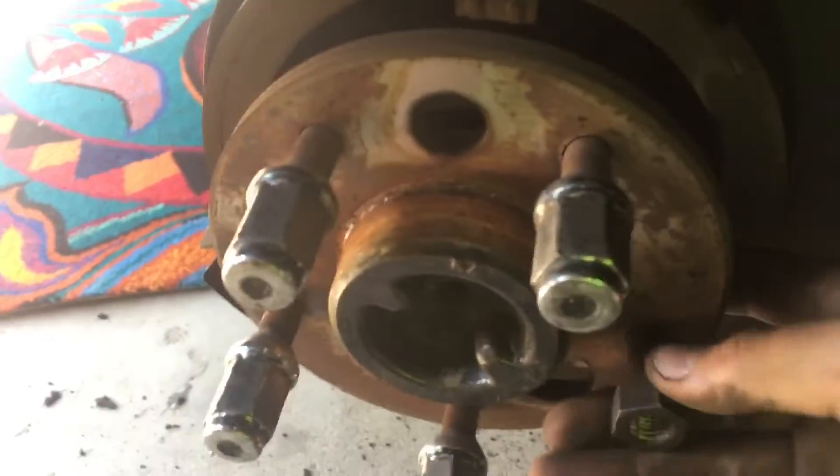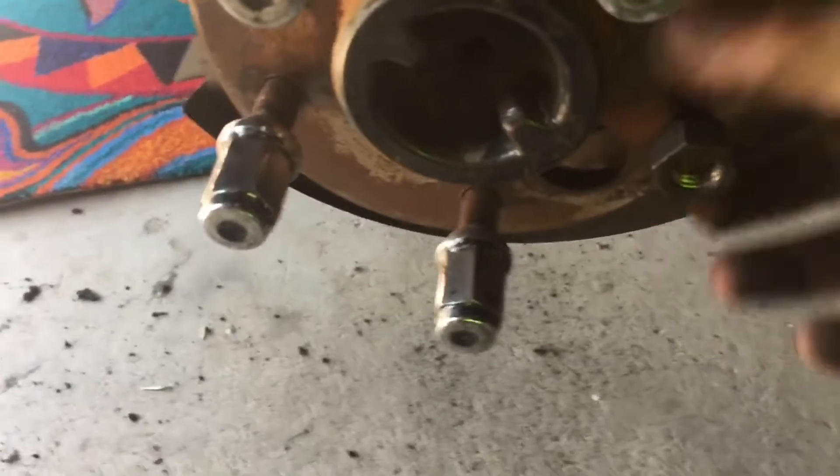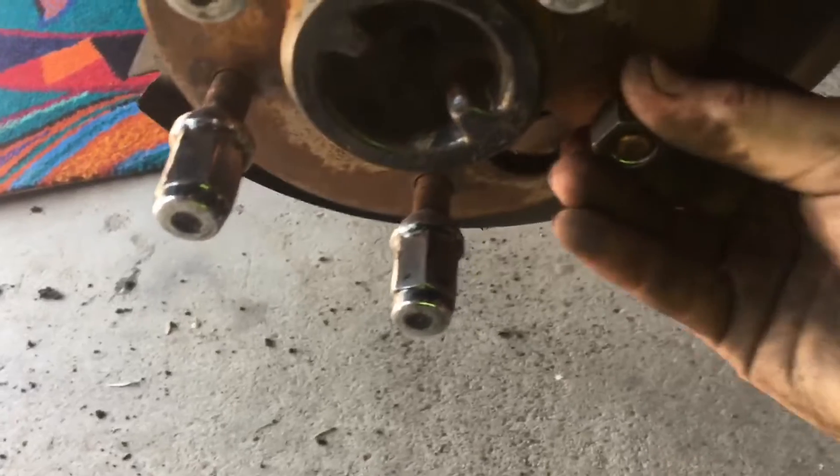Compared to when you're putting your wheels on, the lug nuts don't take up as much thread as when you're trying to pull the stud completely through. So now what I'm gonna do is get my impact - this is gonna be the hard bit.